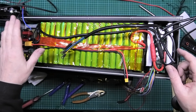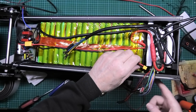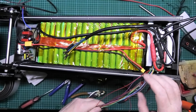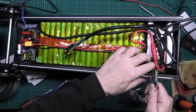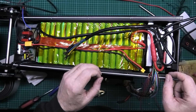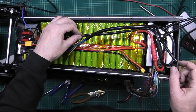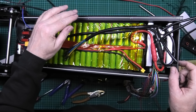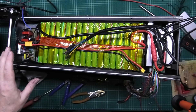The DC to DC is fitted and working, the BMS is working. This here is for the charger which has got to go into this hole here. For those wondering why I didn't use the QS8 — there wasn't enough room. They're a lot bigger and I couldn't have put it on here. I can't put 6 AWG on top because I wouldn't be able to get the case on. I want this to be completely standard by the time I put the casing on so you can't tell what's inside.